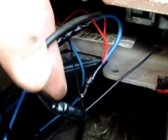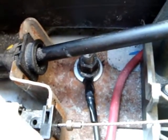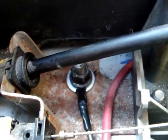I've gone ahead and soldered everything up. My connections, my grounds are all soldered up, all nice and tight there. My grounds and my positives all run up to the front to connect with my forward LEDs. There's my grounds. My ground is connected via a little bolt I have down there for my transmission shifting assembly; I managed to ground it out inside there. Make sure you get a good solid ground. You can never stress enough, you have to have a good ground. 90% of the problems are always related back to the ground.